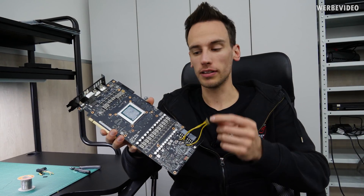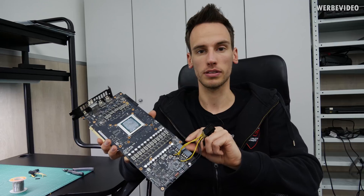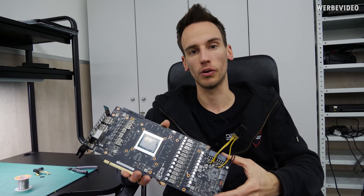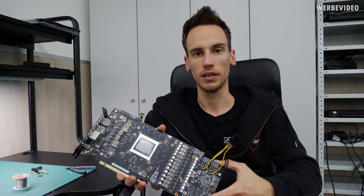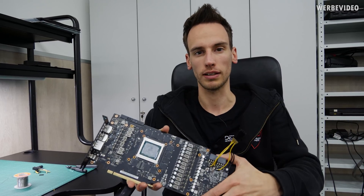The power mod is attached. Now we only have to mount the LN2 container, insulate the card with vaseline, attach the LN2 cooler to the second card, mount the cooler on the CPU, and prepare the whole setup. I think tomorrow we will go for the results, because it's already around 9 PM and once we're done with preparation and checking it'll be 10 or 11.